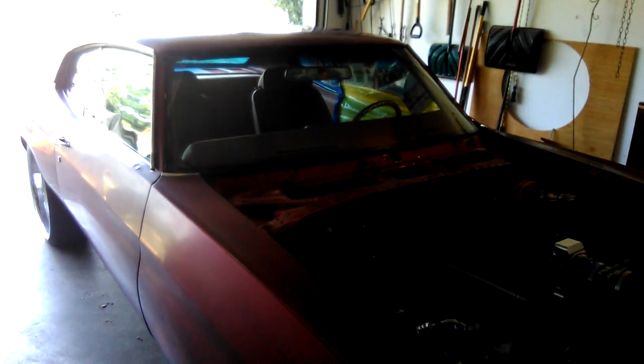But I just wanted to show you a little paint trick. When I prep a car for paint, I want everything perfect so the paint lays down and sticks real nice. Yesterday, originally I was going to tape over the chrome, but I wasn't going to be able to get a nice line around the chrome trim because of the way it was sitting. So I bought this tool. This is a GM trim removal tool, and you just get under the chrome and pop these guys off. The trim will pop off without destroying it, so you can reuse it. It's not all bent up or anything like that. It's going to look factory new.